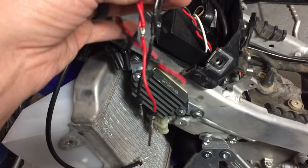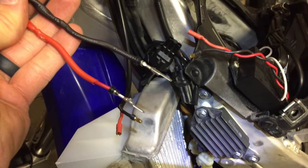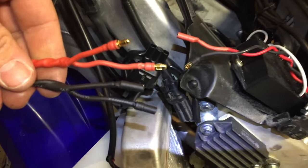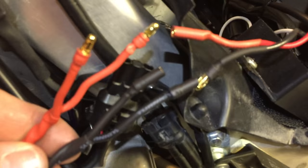Then in the summertime when I unplug the nitrous, I can still have my light plugged in. I got my wires soldered up. Here's the ones that will go in the main power — you see I got bullet connectors on each one. There's the ones for the light and there's the ones for the nitrous. As you can see, only black can go on black and red can't go on black.